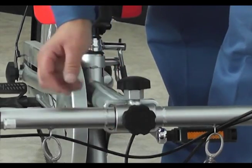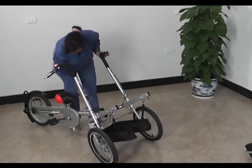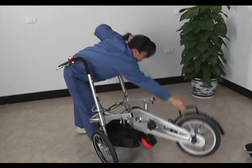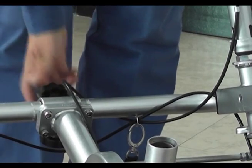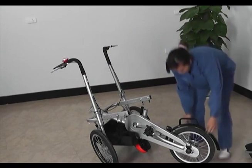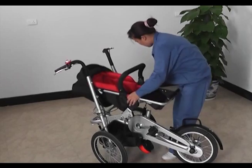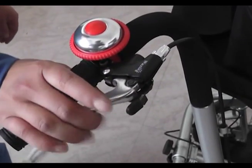Step 6: turn 4 times. Pull up the top button and flip the fender from the back of the frame to the front side. Then tighten the knob on the bottom and tighten the fender. Attach the baby seat and press the right brake to release it. The transition is done.